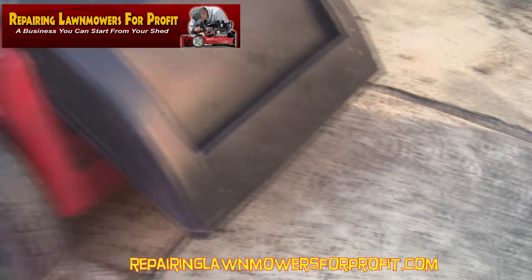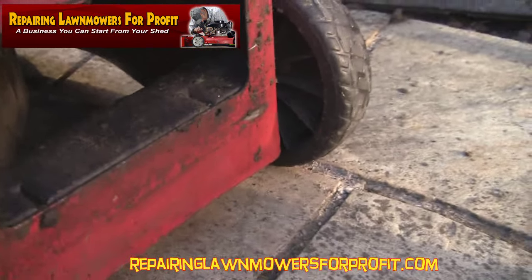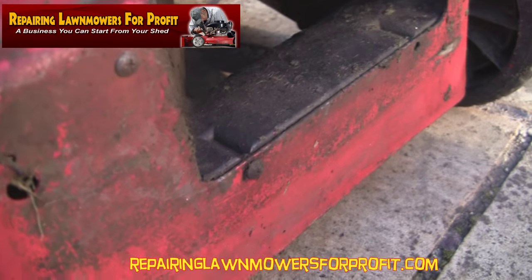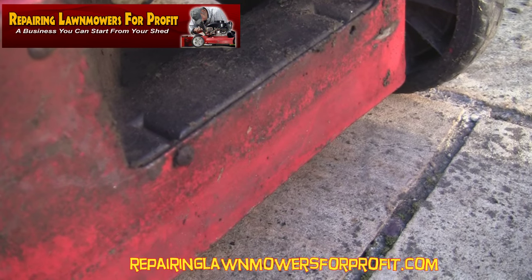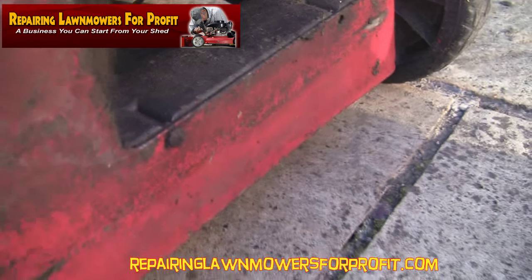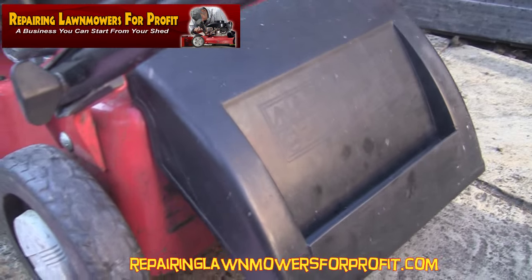It's a little bit unusual, this belt guard. As I've looked, it's actually screwed on at the back. I think there's a total of six screws supposed to be in this, and there's actually just one. Whoever's done it has put it back on with just one — that's really just laziness. I'm going to take that one off and this thing is just going to drop off. I'm surprised it hadn't fallen down with the weight of the grass in it and snapped the belt. I've been very lucky.